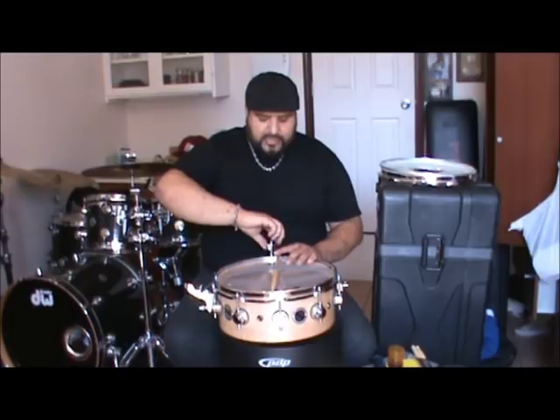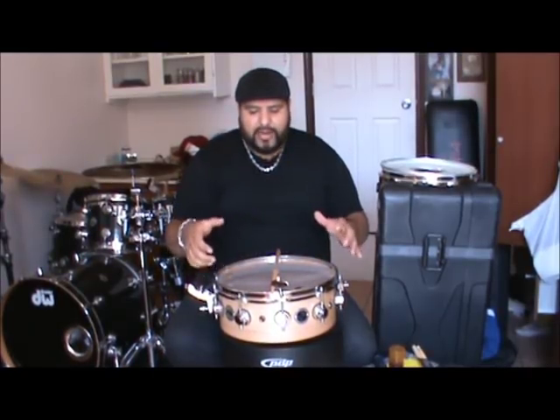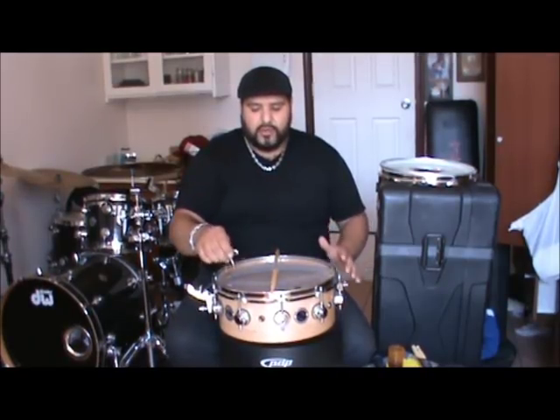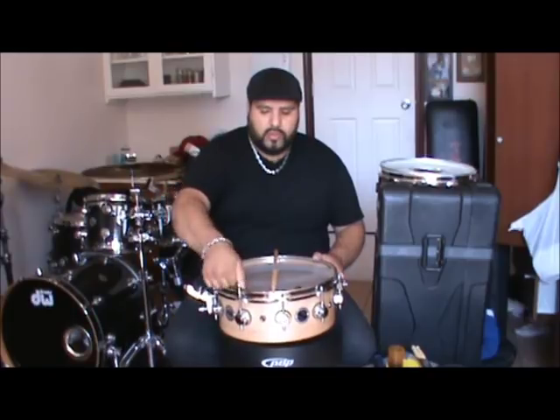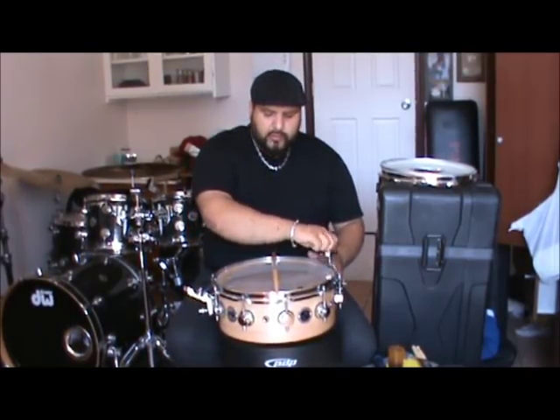I do it like a clock — going clockwise. To me this position is a six, but for you guys it would be 12. So at 12, finger tight, then one complete turn. Then you go to the one across: finger tight, one complete turn. Every time you tighten one lug, the one around it might get loose, so make sure to finger tighten before you give it one full turn. The reason for the clock method is so you won't lose your place. You go to the next one, finger tight, one full turn, then to the one across, finger tight, one full turn — all the way around.